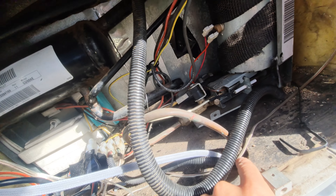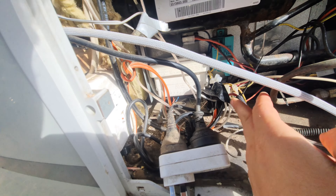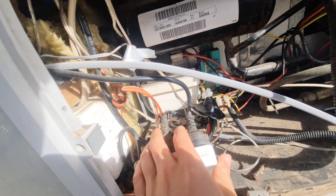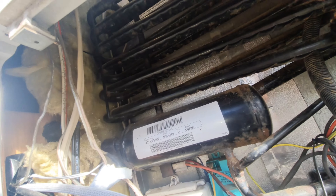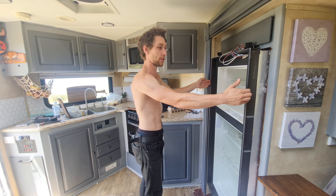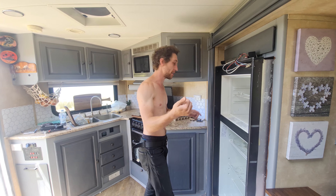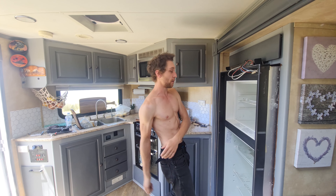Now I should be able to unscrew this and detach that from the system. I'm also planning on disconnecting the power cable and any other cables coming from under here — it looks like it's just a power cable so it should be pretty straightforward. Once you have disconnected the gas and the electricity from the back, make sure you've taped and released to make it safe so it won't arc out on anything. Just push it from the back because it'll be a bit hard from the front.